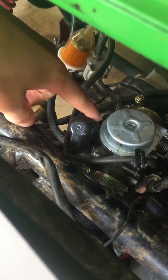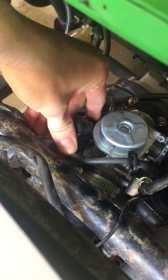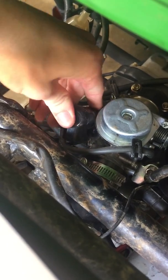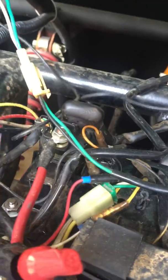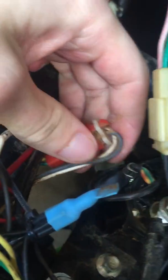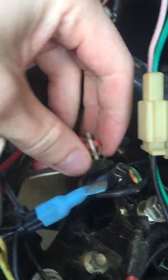There's one last piece that's really important — you can see it down in there with the black cover on it. This is your auto choke; when it's starting that's really important and it won't start without it. You can trace it: this black bundle goes down through here, up through here, and it's connected to this piece right here with gray and white wires.